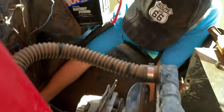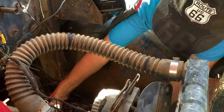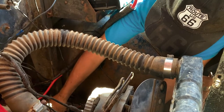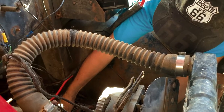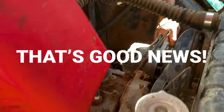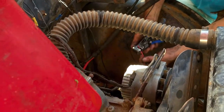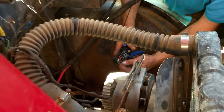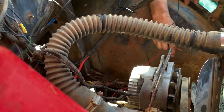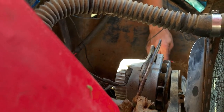So far, it turns over. No backfiring — it fires. Runs for probably 10, 20 revolutions. It tells me that no valves are stuck, because we've got no backfiring, no loud exhaust noises, which is great. That's one of the downsides with these flathead engines — you often end up with a valve stuck, and they're hard to access. Trying to tap them back and forth to free them up, you bend the valve and then you end up needing a full valve job. So I'm very happy with it so far. The basic core engine seems good.